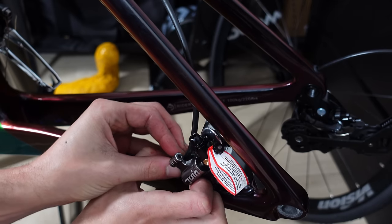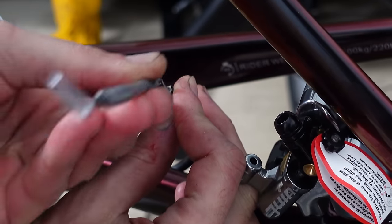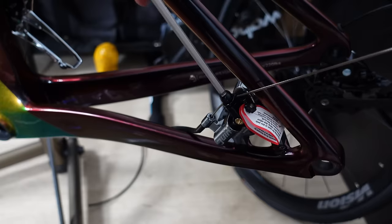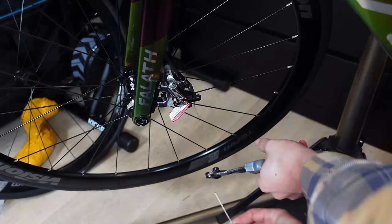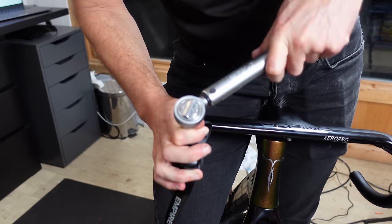On went the POP end caps and I could see how much cable would be needed. I cut the cable down, making sure the ends weren't closed or the inner lining crimped with my dentistry tools. I removed the calipers so I could get these stiff cables into them, then loosely tightened the calipers ready for final adjustment later. To finalise the cable work I cut off the excess inner cable so they weren't dangling everywhere, then used a spirit level to check the shifters were level and tightened the clamp bolts to around five newton meters.